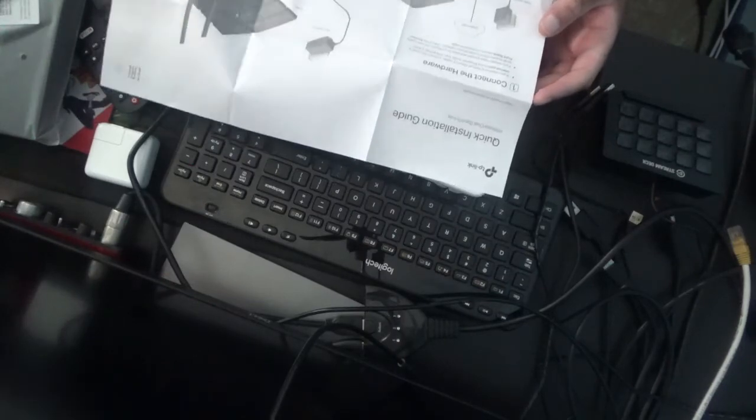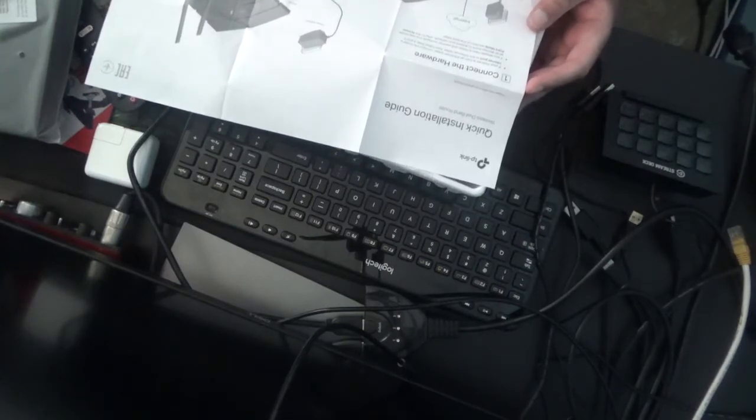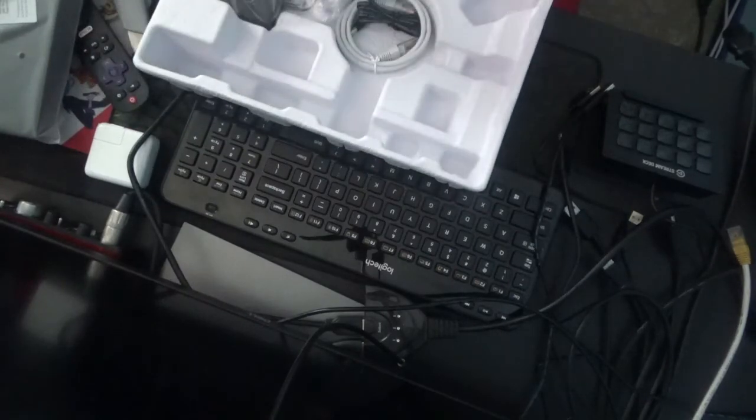And then after that, you unplug it from the WAN and plug it into the LAN, so it's just being accessed as Wi-Fi, and it's not getting an IP address from the WAN. So other than that, that's how you pretty much set that up. Or you can set it up with the app, or you can connect with Wi-Fi. They recommend Tether, scan for Tether, and then connect with your smartphone, or you can just go to tplinkwifi.net and set it up that way.